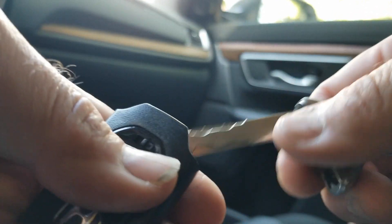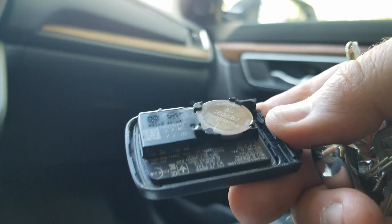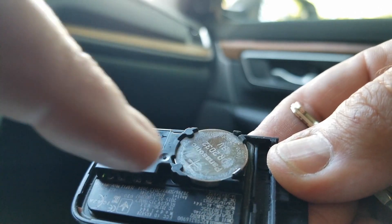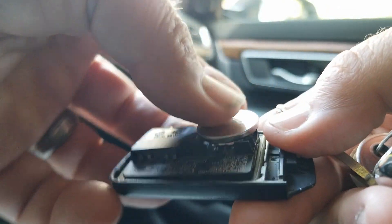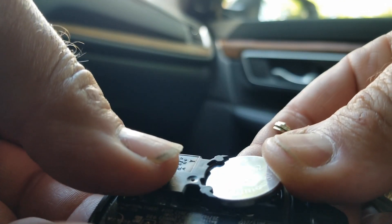What I do is take the little key and pry it to the side just like that, which cracks this open. Pull it open — now this is the part you have to be careful about because this is all plastic, you don't want to break it. Take your fingernail and push this way, prying up, and the battery actually pries up from that location. This section is obviously the negative side of the battery, and the flat side with the writing on it is the positive side. Grab your new CR2032, place it in the same way it came out, give it a push in, and now we should be good.